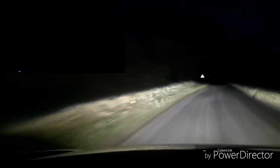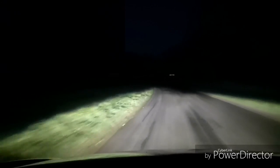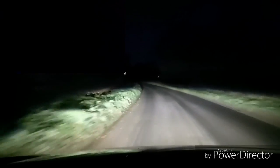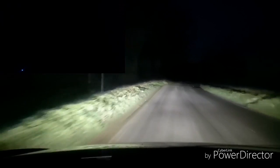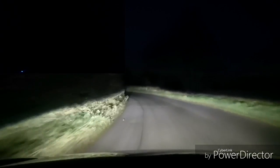Okay, try regen level three. Back up to 40 miles an hour and slowing off now — foot's coming off the throttle, nearly off, now we're off. Yeah, I can see the brake lights are on because in the dark I can actually see it. Okay so back up to 40 miles an hour and again really slowly off the throttle. So the initial taking your foot off the throttle — it's still partly on, the light's not coming on — but then it does come on as you decelerate quite a bit. So that's at 40 miles an hour, off, off, off the throttle completely — yeah, and it's back on again.